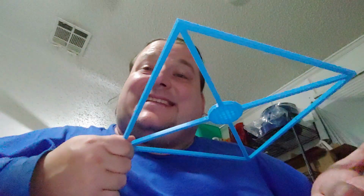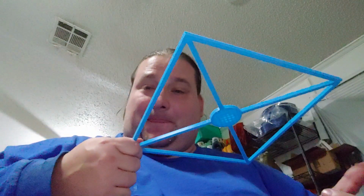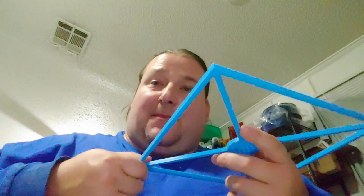That's why you can test your limit switches by telling the printer to home, being careful to watch where your finger goes, and you can actually go in there and go click and hit the switch, and you'll see the motor stops wherever it is, even though it hasn't reached home. Well, what's happening on his printer is it thinks it's already at home. So what happens if you're already at home? You stop moving.